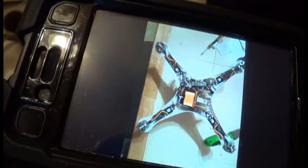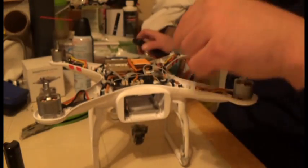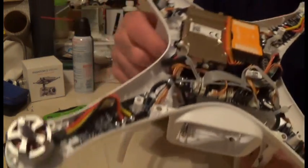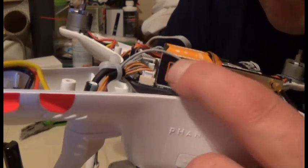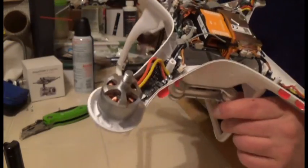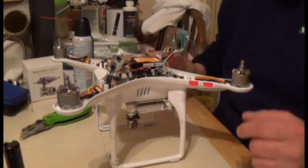You want a reference point because you're going to be checking wires and soldering — doing an overhaul inspection. If a wire comes loose while you're working and you don't notice it, you might not know where it goes. That picture makes life easier — for example, if this wire fell out I wouldn't know where to put it. So take pictures all around to use as a reference.